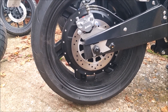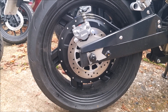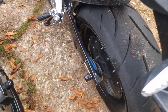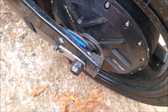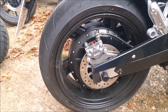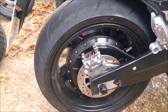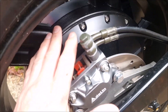Why is that important? Well, if it's centrally mounted with a chain or belt, those transmissions give away energy, so you'd expect a hub motor to be more efficient in terms of what you actually get at the wheel from the battery. There's also less maintenance since everything's contained — no moving parts. You can see the cables going directly into the hub motor. However, you are putting a bit of weight into that back wheel, whereas with a centrally mounted motor that weight sits more centrally.